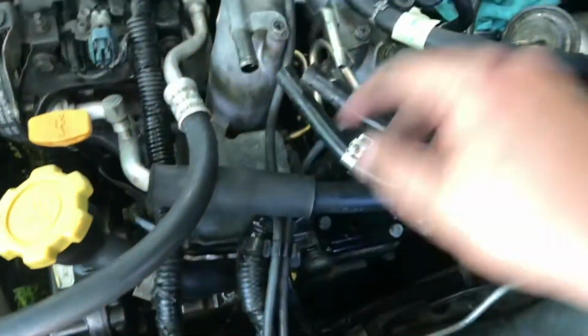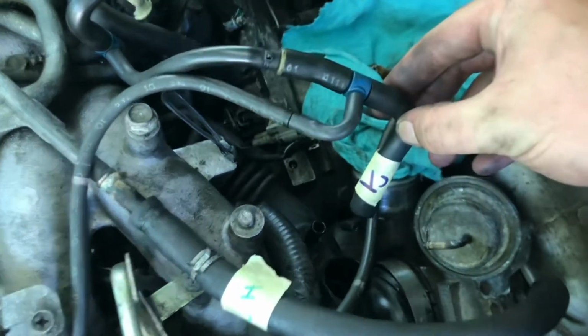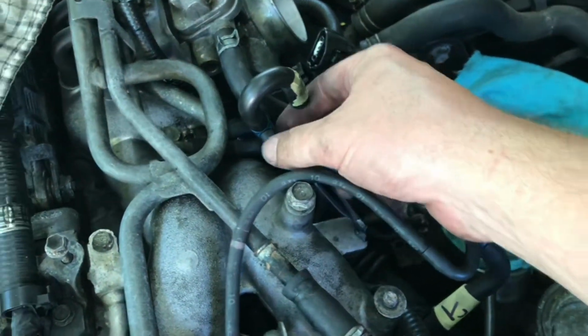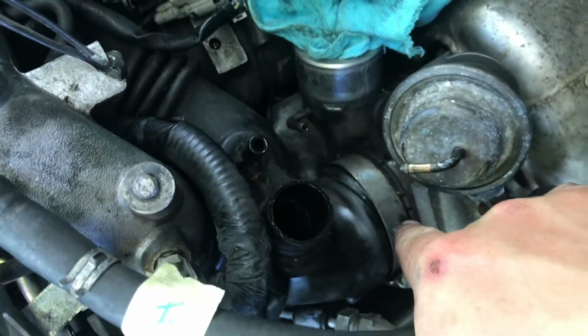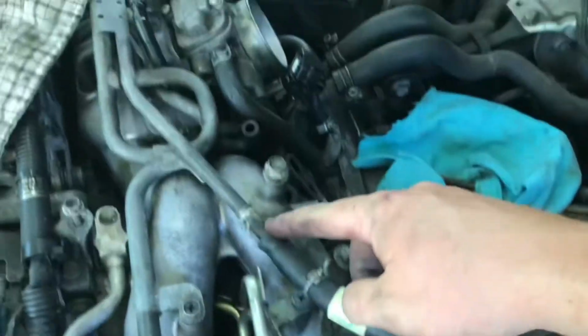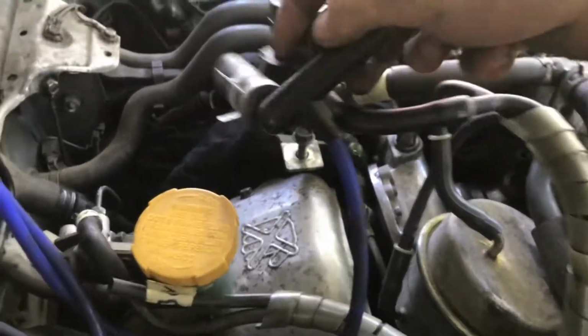And then the second one is this assortment here. It goes down into the turbo duct pipe, which is what I'm going to be changing. It tees off, runs along here to the inlet manifold, and this goes onto the blow-off valve, which is on the intercooler. So that can go away. Next I'm going to pop off the hose clamps for that turbo and that turbo, and then there's the coolant line coming off the manifold for this turbo. I've taken off the F pipe, which is this piece here, which sits like that.